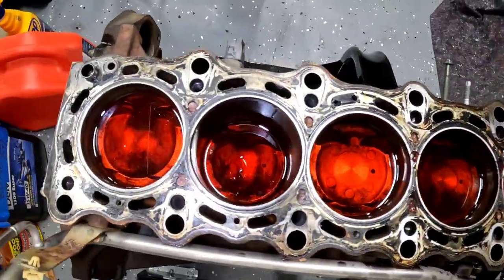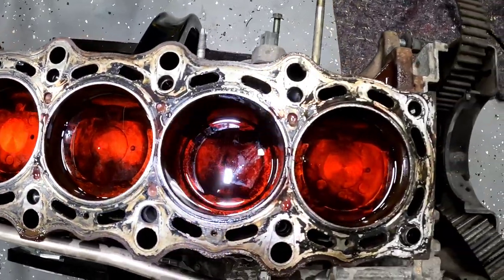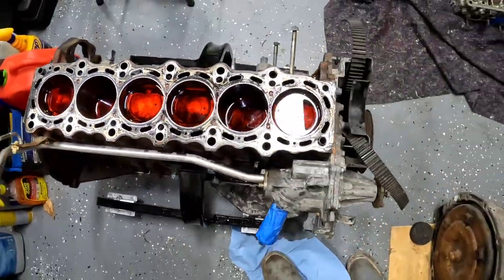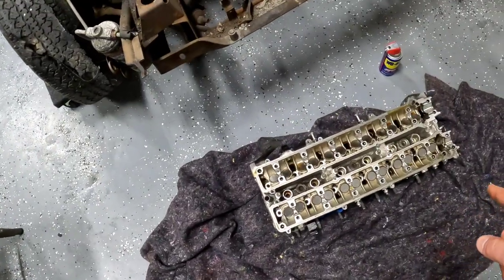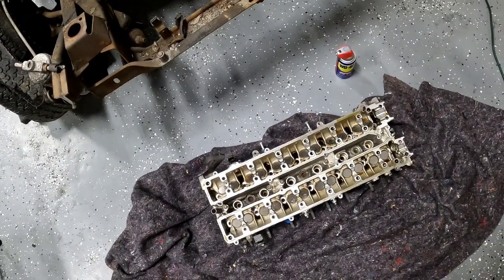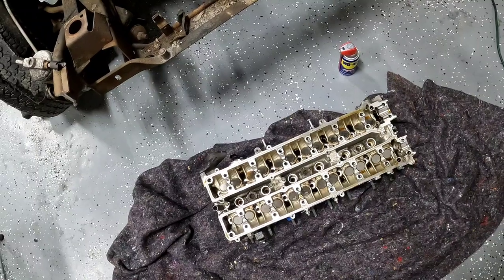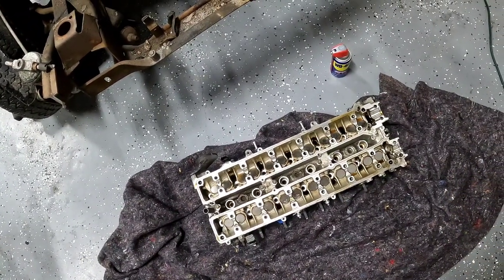I've got some Marvel Mystery Oil just sitting on each piston so it'll lube up those cylinder bores when I rotate it with the crank and start breaking up the top of those pistons. Then I'll be able to clean everything and make it look brand new. Super happy with this motor. I'm waiting for a tool to show up — I went ahead and just bought the snazzy 2J's valve compressor tool that lets me lift those bad boys up and pop those keepers out really easily. So for now, thanks for joining me — hit that like button, subscribe. Next time I bring you back, we're going to start building this thing. I'm going to scrub the block, paint it, pull the head apart, and basically go through detailed reassembly. Might be a couple more videos, but I think that's long enough for today. We'll see you next time — Timeless Steel Garage. Thanks.